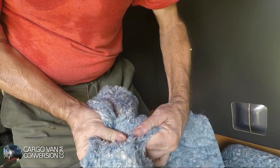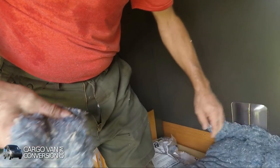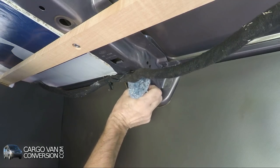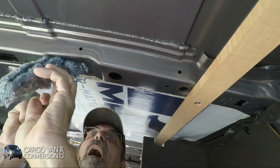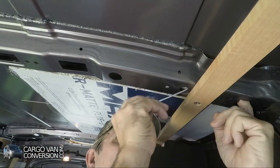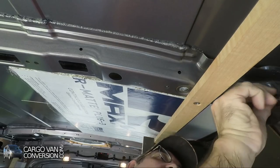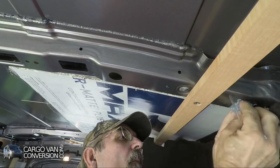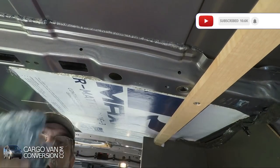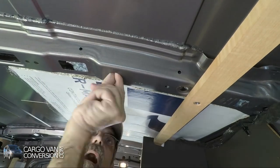That leaves me about a foot or so in storage room behind it. But before that, I really need to do some insulation of the ceiling because at a certain point I can't reach that anymore. Most of my wiring will be on the passenger side of the car, so I'll have to start working on the wiring too before putting all kinds of cabinets in. What I decided to do with the ceiling is use three half-inch layers of polyiso, and then on top of that will be some luan to cover the insulation.